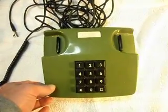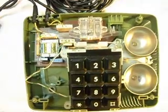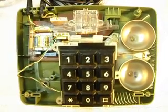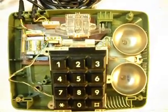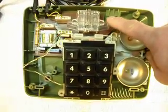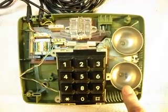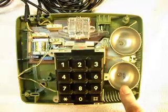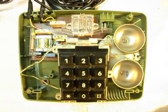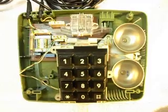These are cool telephones, they've got a history behind them, and you just don't find stuff like this in America. I've got the cover off, and this will show you a little bit about what this telephone looks like on the inside. We have to install a new board and wire the keypad to it for the tone generator. We configure and convert this telephone so that we still have our original hook switch. I do believe we keep the bell, because this has a bell setting on the outside — you can go high or low. We also want to install a switch on the back so that the bell can be completely turned off, and I believe that's what the customer wanted.